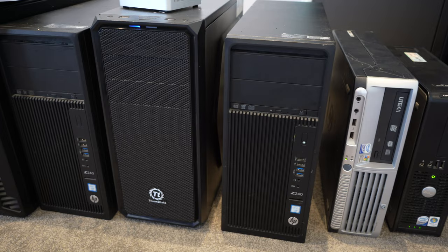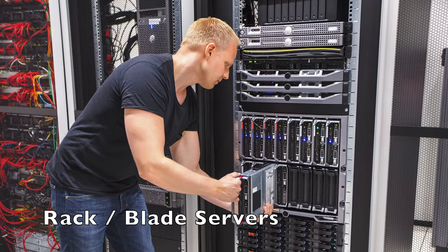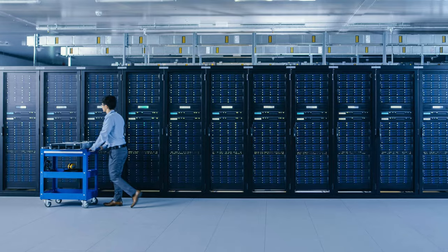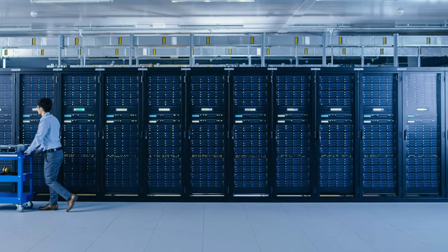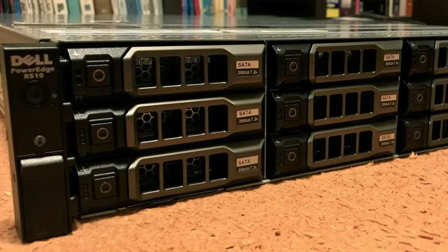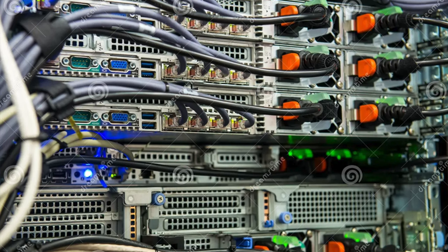With something a little bit bigger, you can have much better resources inside of it. These sorts of servers are really more high-end, a lot more high-powered, and you're commonly going to find them in an enterprise or a business. You could look at rack servers or blade servers — they come in different configurations, some skinny, some thicker, and bigger still. You can deploy them with certain RAID configurations, you have redundancy, you've got a lot more network points, and you may even have options around fiber channel connections.